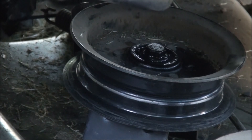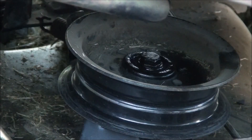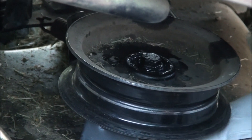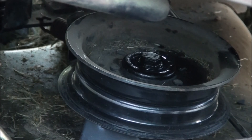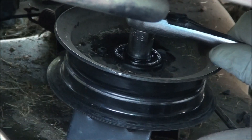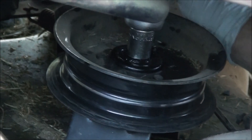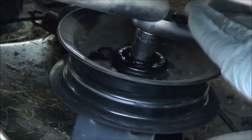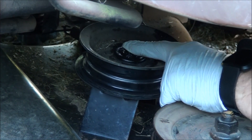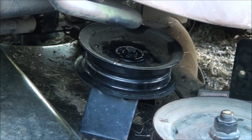Let's get to this pulley here and see if we can get it off easy enough so we can bend the tab a little bit closer to it. Looks like that's a nine-sixteenths. I wonder if there's a spot underneath that I have to hold — we'll find out if it loosens up. It looks like the left side here is a bolt and there is a nut on the bottom of this bracket that you have to hold, and I believe it's a nine-sixteenths.